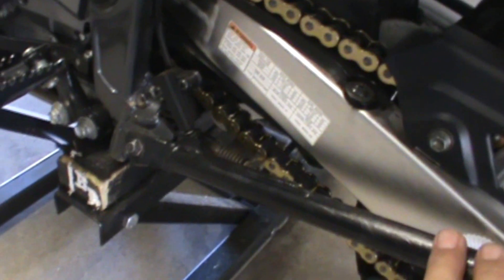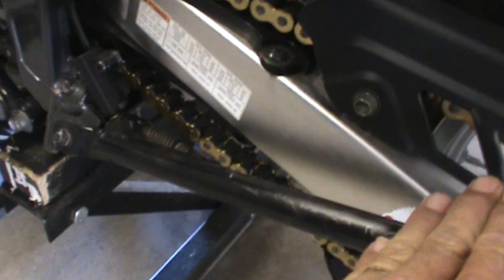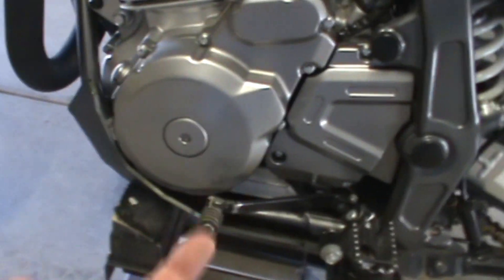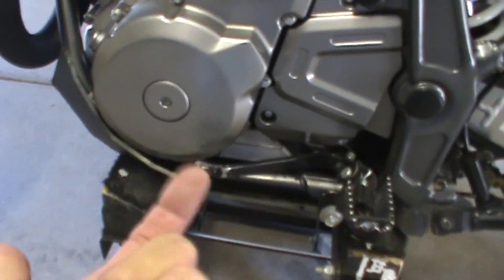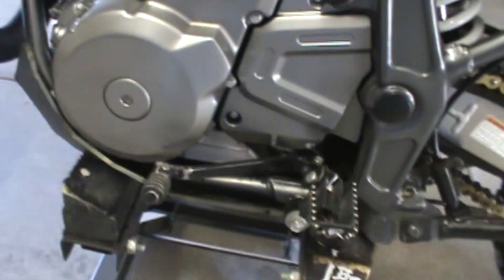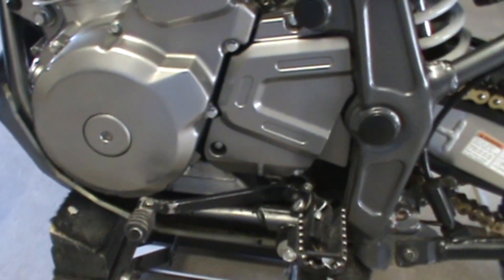Used to be an upper chain roller — remove it and put in a little bolt, I think it's 10mm by 25 — so water and crap doesn't get down in that hole. Kickstand safety switch: when you're in gear out in the desert going over whoops or a big jump, if the kickstand comes down just a fuzz, it'll kill the motor. Don't be disabling anything you're not comfortable with. For the oil drain plug underneath, I got mine from Moose Racing — it's a magnetic oil drain plug. Whenever you change your oil, if you see metal flakes on that plug, you're going to want to get that investigated.